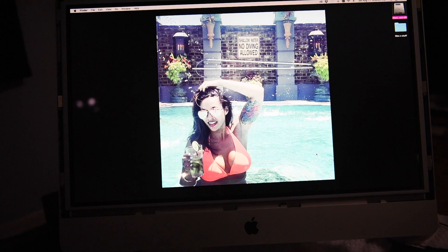These iMacs had an issue where there was a piece that connected to the screen and the solder would melt on it, the piece would come loose, and the screen would start to blink out and go black occasionally. It has nothing to do with this because this is a brand new screen — I replaced it a long time ago, like three years after I got it.